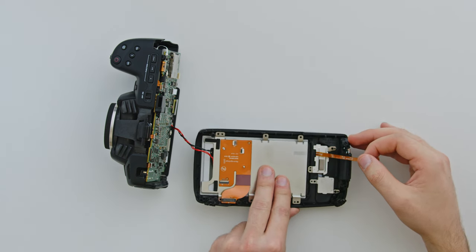If you are experiencing any issues with the display working or touch sensitivity, it's likely that one of the connections between the LCD and the camera is too loose — this can happen quite often. If this has happened, I'd recommend taking a rest and coming back later. If you do need to troubleshoot, start by removing the back of the display to disconnect and reconnect the ribbon cables there. If this doesn't work, then it's most likely to be the LCD ribbon cable connections inside the camera. Because the camera is not bolted together, you'll only need to disconnect the cables in the back of the display, remove the display enclosure, and open the camera to regain access to the LCD's connections. Remember to be patient and delicate with these parts, and again, it can help to return to do this job after a rest.